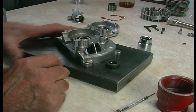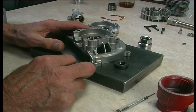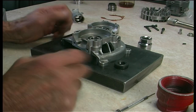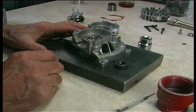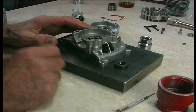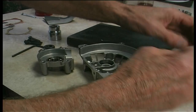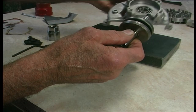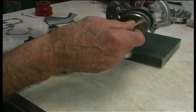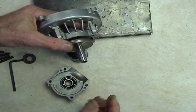In an engine of this size, yes it's air-cooled, so we'll have a slightly greater variation of expansion and contraction compared to a water-cooled engine — but it still needs to be minimal. We're now ready to refit our crank. Let the piston hang down, poke them in — beautiful fit, just like that.